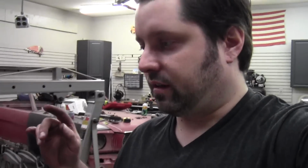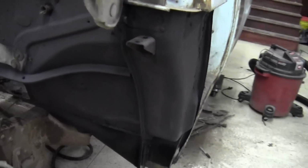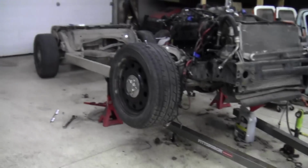So yeah, sorry this one's short because of corrupt files, but the next video will be removing this evap canister and the lines for that, and then starting to build the brackets. And we're going to cut out the step on the pickup right here, because the Crown Vic frame rail will sit right in here. So we need to cut this out, then cut out these fancy new cab mounts from Carolina Classics that I just installed. So we're going to still use them. We're just going to cut a channel into them for the Crown Vic. And that's really all we'll have to do to be able to get the truck onto the frame.